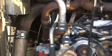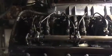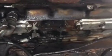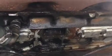We just did a quick compression test on it, seeing how many cylinders were down. Number two is definitely down, and another one on the other side has water coming out of the slobber tube or airbox drains.